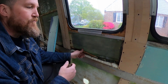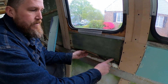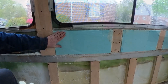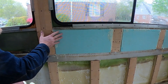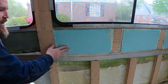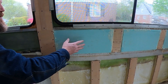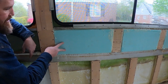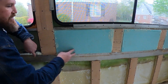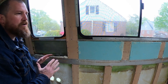The way I'm approaching this is I'm running a half-inch piece of foam board behind the harness, and then running the two three-quarter-inch pieces that are just shy of this piece — this will get injected with spray foam. These ones over here have a half-inch piece against the outside wall, and the second layer is three-quarter-inch strips that have the wires running through them. These actually have the wires for the senders for the gas tanks and the fuel pump running through here. I'm also marking the wood with W's to know not to drill in those areas. There are two wires running right here, leaving two little grooves inside the foam. Then this last piece laminated over top seals it in place — solid as a rock. I'm really happy with the way this is turning out.